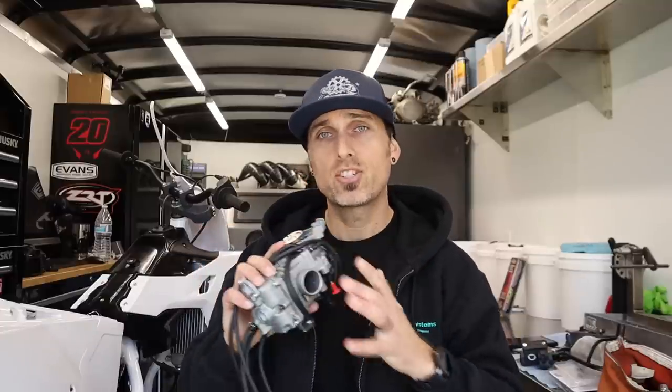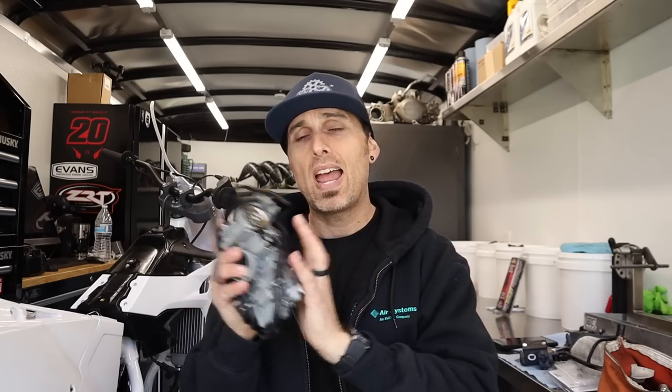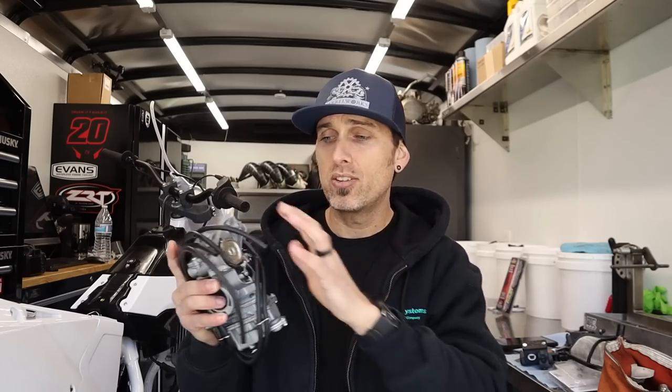This is a 33mm FCR. I had a chance to ride JR's modified SR300s at Glen Helen on the actual motocross track — I'll link that video below. Those bikes absolutely ripped. At the time the FCR clone wasn't out yet, so he'd stuffed a 33mm genuine Honda FCR from a CRF150R into one of the 300s. If you're searching eBay you can do that too. The bike was incredible versus the stock 2020. There are some things this clone carburetor is lacking compared to a genuine FCR — one being that a genuine FCR has a push-pull cable, whereas this one is pull-only. It snaps back fine thanks to the spring, but it's worth noting.